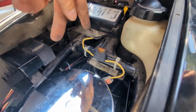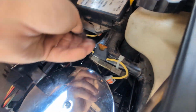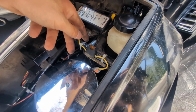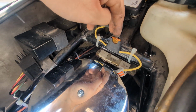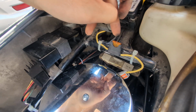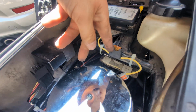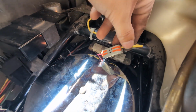So the one for the heater comes right down through a Wago connector, just because I tucked it under there. It fits really nicely. And then, pardon the fire truck, then into a 5 amp fuse. I did the math. My dad's an electrician, so he helped me with this. We discovered a 5 amp fuse is enough. So into this fuse holder I bought at Walmart, into another Wago, into this wire.